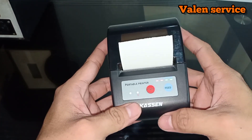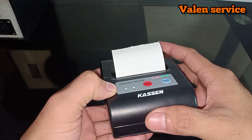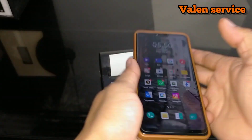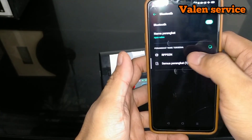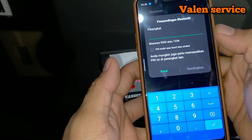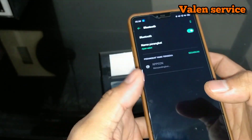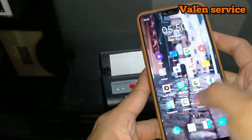Okay, let's turn it on first. It's already on. All the indicator lights are on. And it's already searching for Bluetooth, blinking like this. Let's try connecting this printer via Bluetooth on the phone. I'll prepare the phone. We turn on the Bluetooth. We've found the Bluetooth device — RPP02N, that's the Bluetooth name. We pair it. Pairing uses a PIN: 0000, four zeros. Now it's connected.